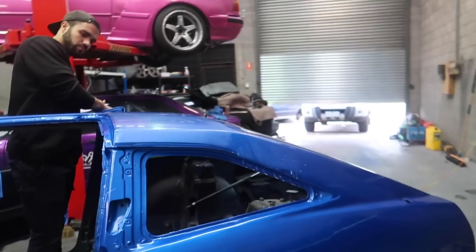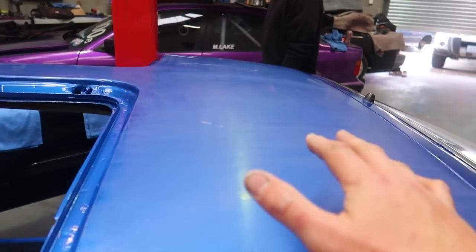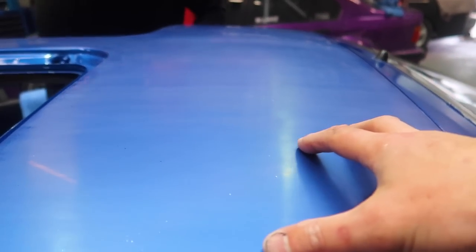Alrighty, Tara's gone, but we are still here working super hard on the 280, carrying on with this beautiful car. It is very rainy and crappy outside, but we've finally got the wet sanding equation down. It took a bit of experimenting in spots, which is very scary on a car that you've freshly painted. But it's something that we really wanted to do because we want this car to look perfect pretty much. So we're gonna watch Dan polish it and see it go from misty to glossy.